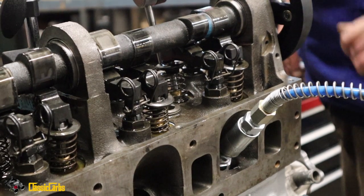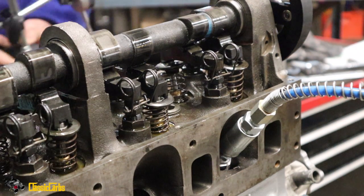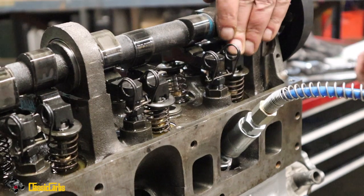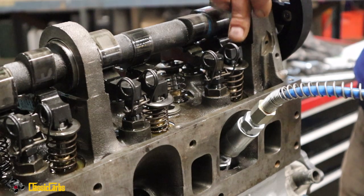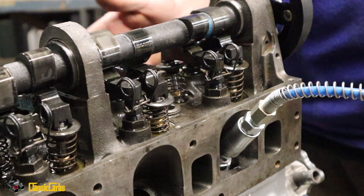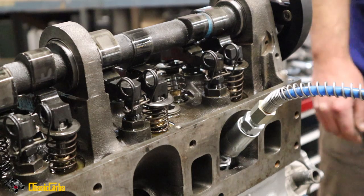I can't even open the freaking valve. That's insane, man. Okay. That is some freaking pressure, man. And it all seems to be leaking on the exhaust, which is what was hitting yesterday. I can't hear any coming from this side, which is the inlet. Yeah. I think we've got a bent valve. Bloody hell.